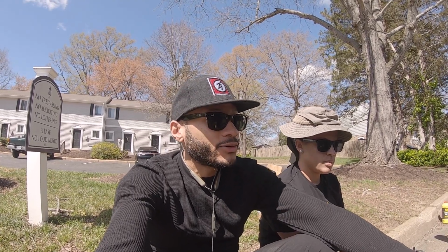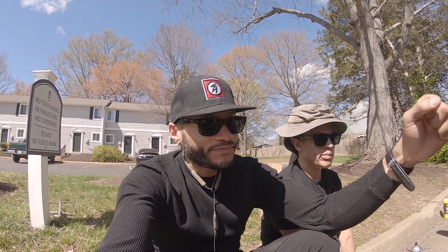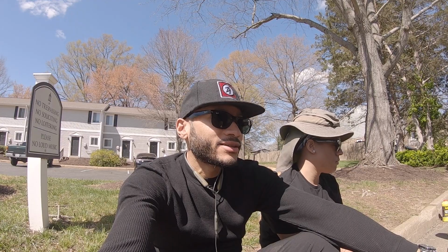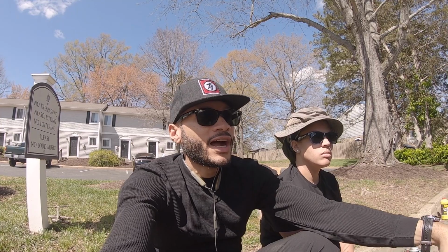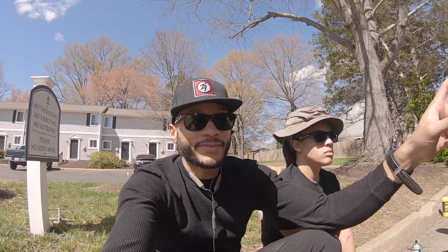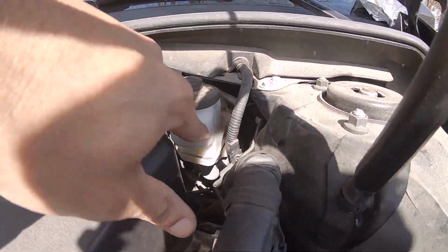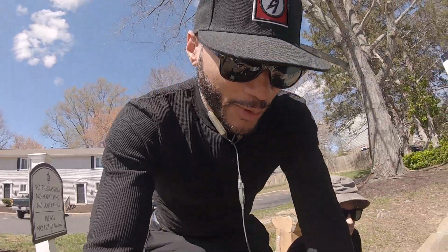I said I was gonna probably do a brake bleed, but I don't have the right adapter for my brake bleeder kit, so we're not gonna do that. The brake fluid does look pretty clean already anyway, and when you do compress the piston, make sure you have enough space in your reservoir to catch the fluid, because it's gonna push brake fluid back. So we probably actually do need to take some out. So this is the level. It's above the max line right there, so we've got to take that down. We'll put it at the correct level, and we will be good to go.